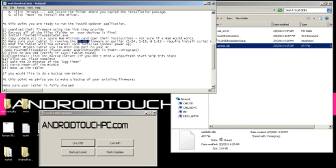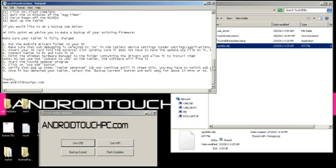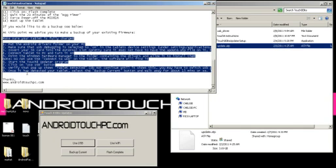Alright. So, step 10, optional, click on Backup Current. We advise you to back up your current ROM, whether it be the factory ROM or the ROM that you've already updated yourself, just in case you don't like this particular ROM or yours is better in your opinion. You can back up your ROM here. It will create an image on the SD card which you can copy over to your PC. And here's the steps to do a backup.